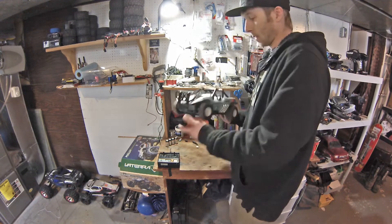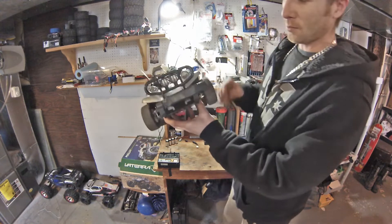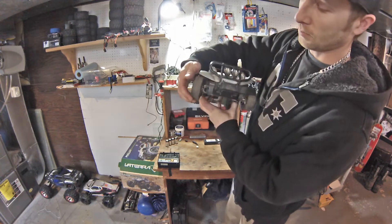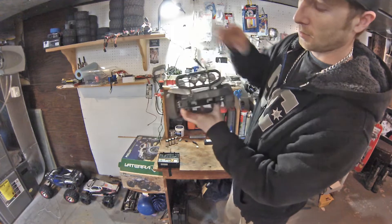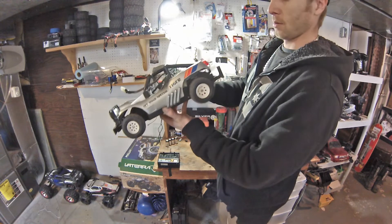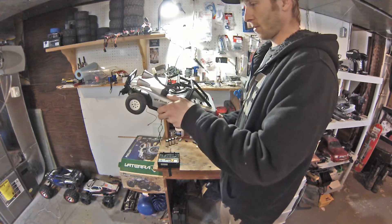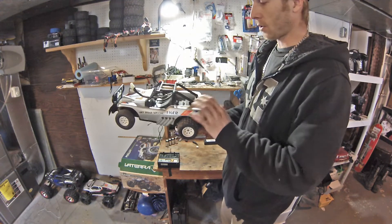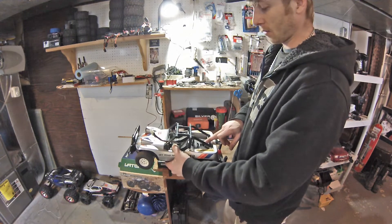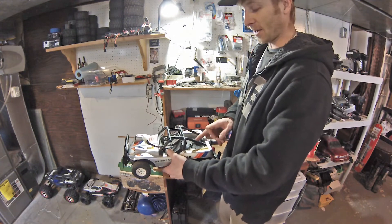This buggy, like I said, it's from 1983. It doesn't have shocks anymore — it did, but it was missing a spring, so I just put screws in so it doesn't travel anymore. They probably didn't work too well to start with. No shocks in the back either, but it does have a POSI, so that's cool. It's got a selector in the bed for high, low, and medium. I was surprised it actually had a medium gear — that gear works pretty good.